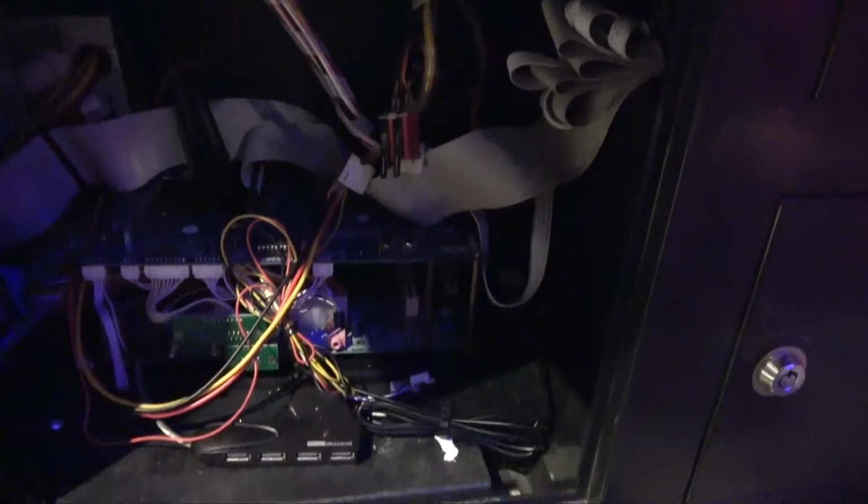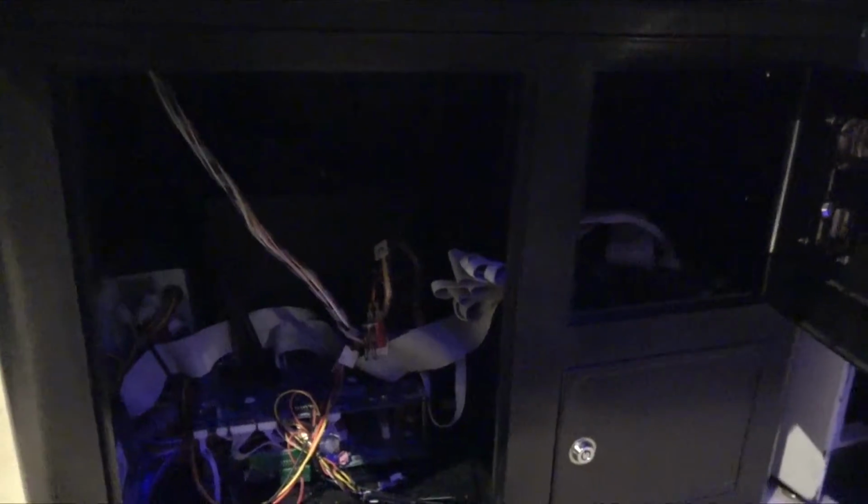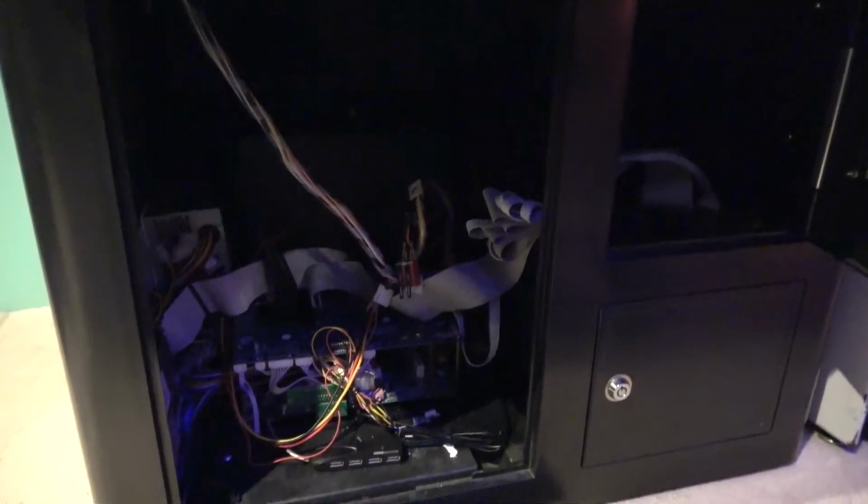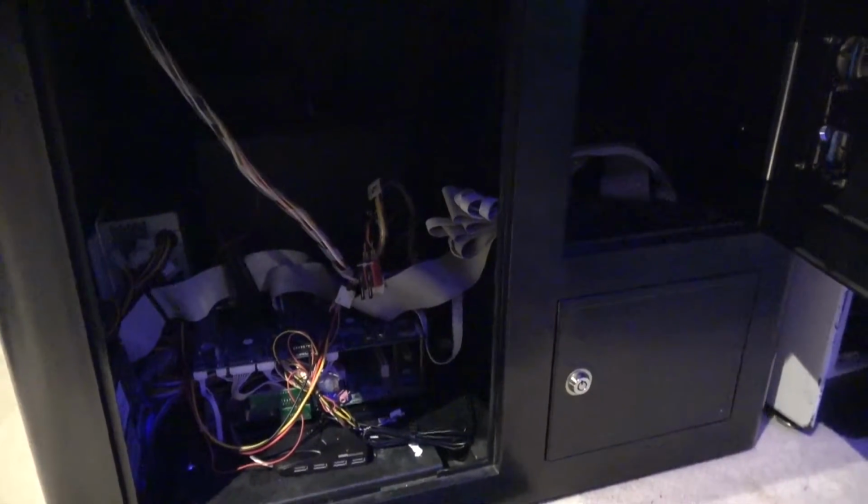Inside, we have a Games Family setup, which is effectively just a small form factor PC. On the top it has a JAMMA board, a JAMMA harness, and a power supply. There's a PC power supply in there, another supply for the monitor, and that's really it. And it's got another small daughter board, which I've got up here somewhere, used for 3 and 4 players. You can actually hook this up to another Candy Cab. So you could have 2 of these, with players 1 and 2 playing on one cab, and 3 and 4 playing on the other cab. And the Sega Blast does some similar stuff, but obviously with different hardware.